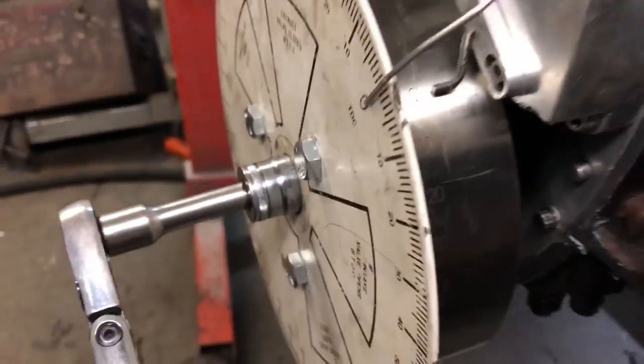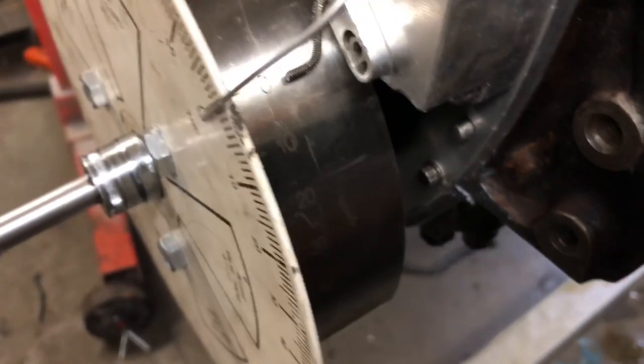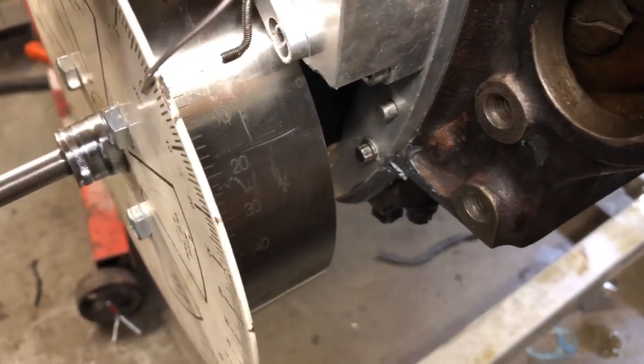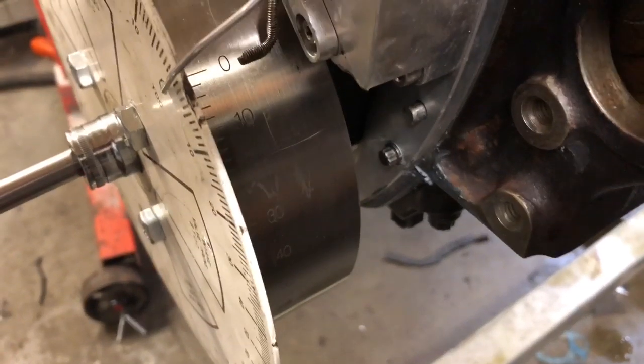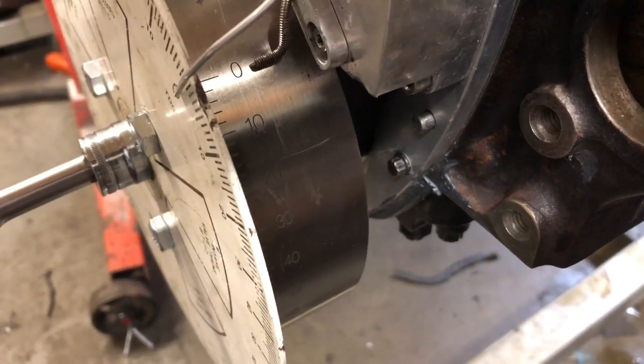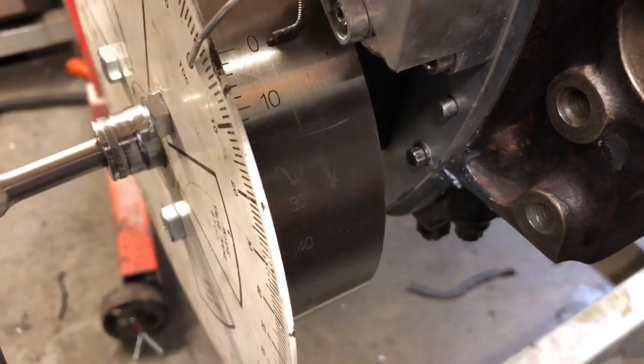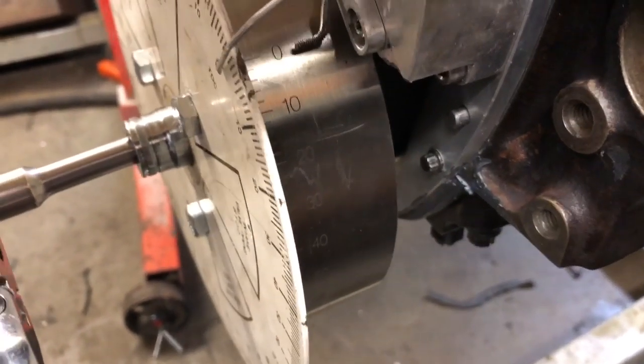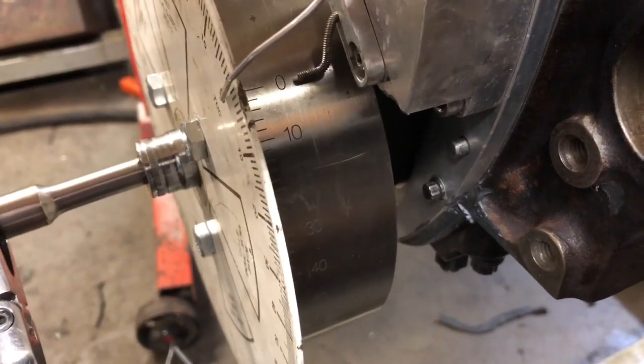And then when you look at my marker on my crankshaft, it's kind of hard to see. Let's see if I can block some light without destroying everything. So you can see that is pretty close. When I'm looking down at it, that is dead on when I've got a timing light flashing on it. So that's how you make sure that you find top dead center.